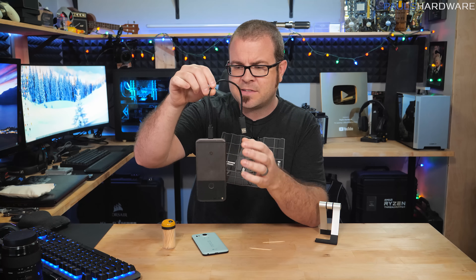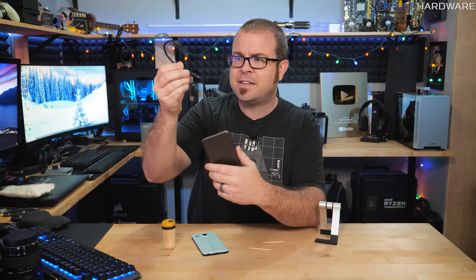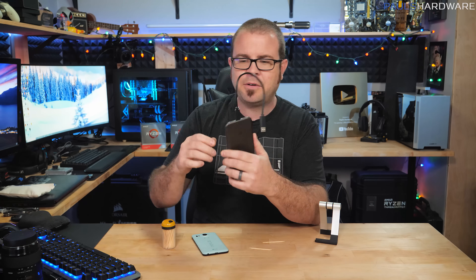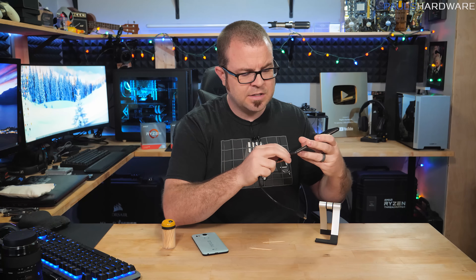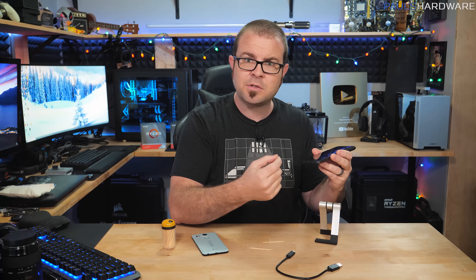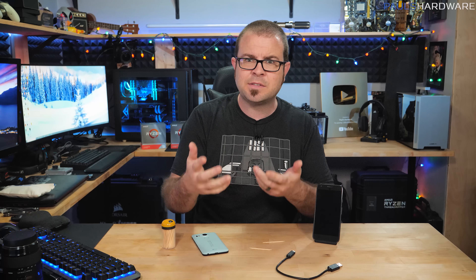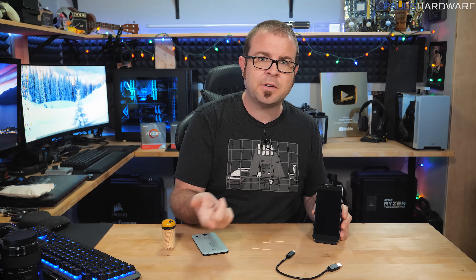Apart from this trick not working because Type-C ports do have little detents in them that sort of help it to stay gripped into the slot and not pop out easily, other symptoms of a clogged port are that it might not charge fast or it might just do slow charging, whereas before it did fast charging. And then if you ever plug your phone into a computer to copy stuff off of it or transfer stuff onto it, you might just be completely unable to get a data connection going between your phone and your computer.